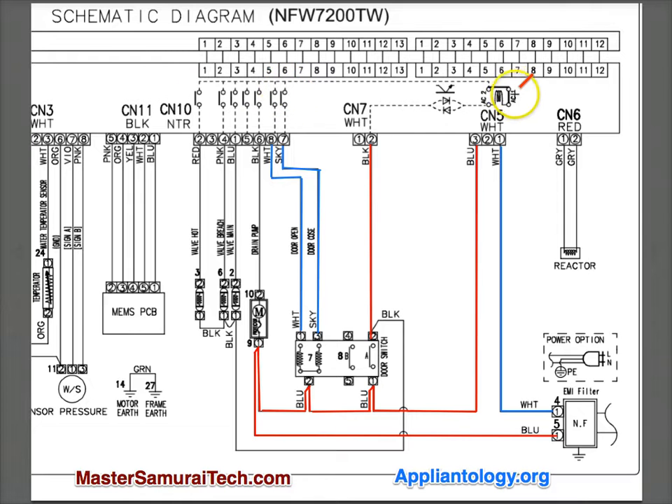Once this coil is energized, the board is saying we've got a good door switch, so the relay supplies whichever one - line or neutral - to complete the circuit for these loads. All of these switches here are relay contacts on the control board, just not showing the coil. If you want to go with the analysis that blue is neutral and red is line, that's fine. You can even switch them - blue as line and red as neutral. It works either way. They just have to be opposite when across a load and the same when going through a switch.